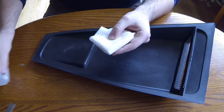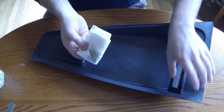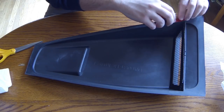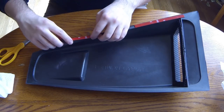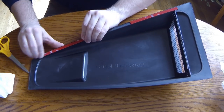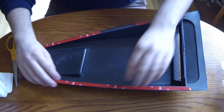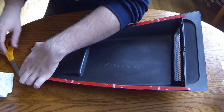So now we're gonna put the tape on that actually holds the scoop to the side of the car. Make sure you wipe it down — look at all that dirt that came off. Use the half strips of tape, and you want to make sure you leave a gap at the bottom edge of the scoop, which is the longer edge, to release any water that gets caught up inside the scoop. Then you want to get the corners down really tight, cause that's where it's going to want to pull up the most.